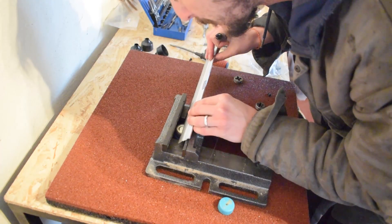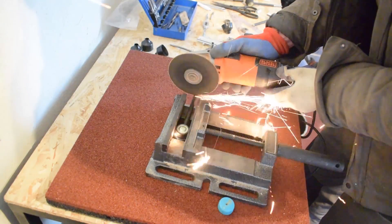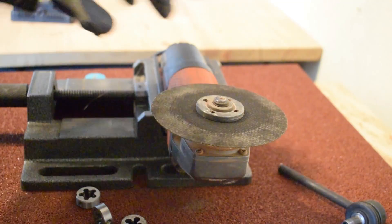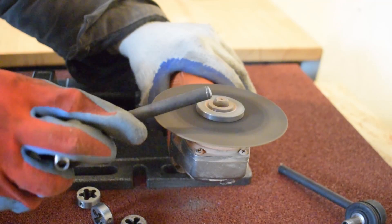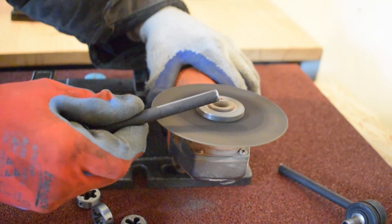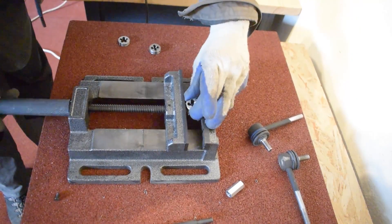Once you've purchased them, it's time to cut them down to size. This is super easy — just get an angle grinder, measure twice, cut once. Once cut, it's time to thread the rods using threading dies. Depending on the thickness of your sway bar links, you'll probably use an M8, M10, or M12 die. In my case, my sway bar link was too thin for the M12 die and too thick for the M10, so I used my angle grinder again to reduce the thickness of the rods carefully and evenly.